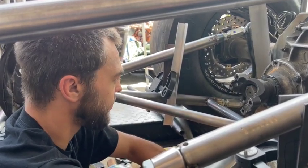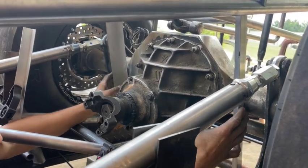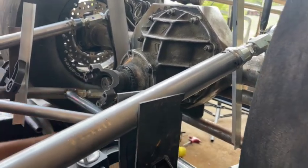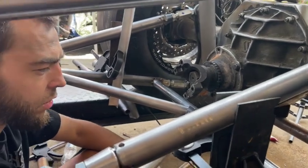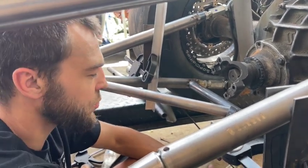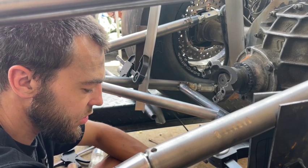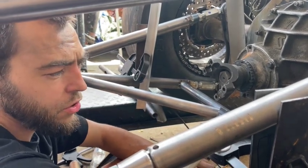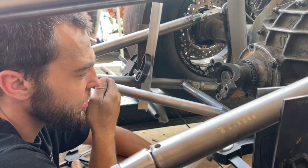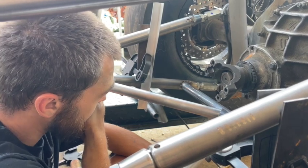As you can see in the video, this angle aluminum is very nice because it has a very crisp 90-degree edge. When I'm measuring the distance to make sure the rear end is centered, I cross-measured it as well — it's very accurate, within 1/32nd of an inch. The rear end is square in there. On this car I decided to start off square; on a big tire car you'll often set up the car with a little bit of rear steer built in, but we don't have to do that right now.